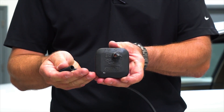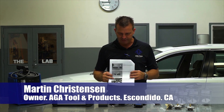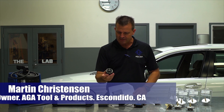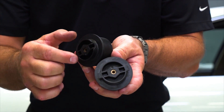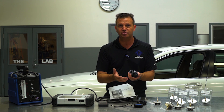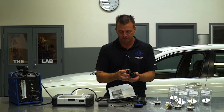There are a lot of different ways to do that. If you are going with the official test plan and they tell you to use the BMW tool, this tool has had a problem with the little connectors breaking off and ending up inside of the engine crankcase. Since they are plastic and not magnetic, they are very difficult to retrieve and typically end up requiring removal of the valve cover.